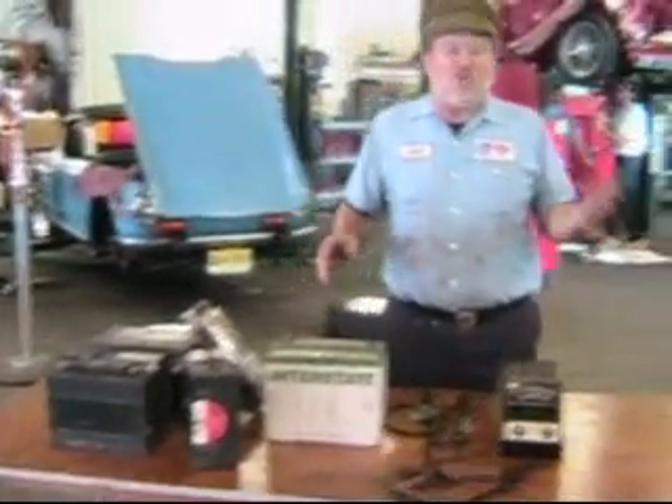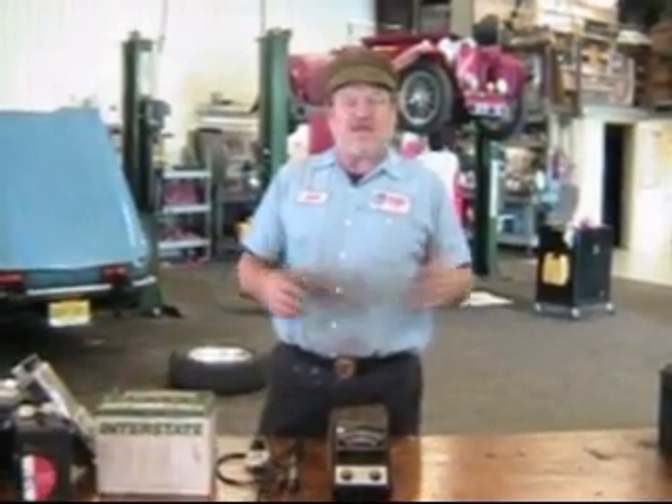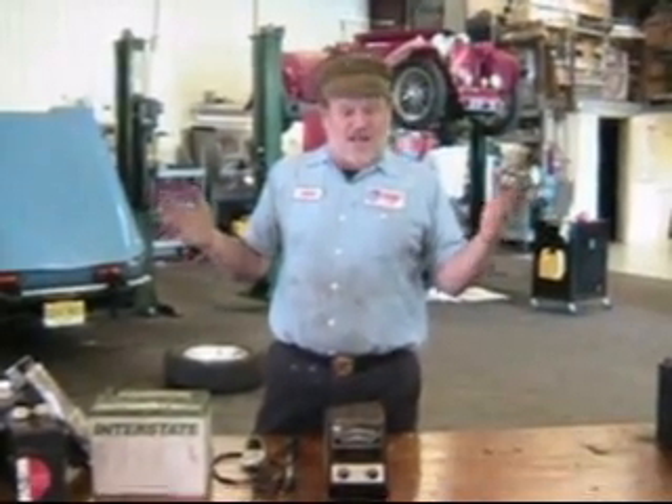What does a battery do? It provides a reserve for electricity. It's like a water tower — it's got a lot of energy inside it. Once it's drained, you can refill it. It's a storage battery. So just because the battery is dead doesn't mean it's bad; it just means that it needs to be refilled. It's used to start the car when you need a 150-amp burst to go into the starter motor. It's also used around idle when the car is not making enough electricity off the generator or alternator to run the lights and the heater motor. So it provides electricity down around idle to keep the car running, and it acts as a ballast to hold the whole system at around 13 to 14 volts. I know it's called a 12-volt battery, but it's not — it's a 13.2-volt battery.